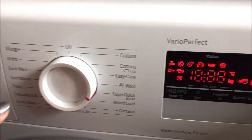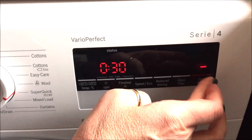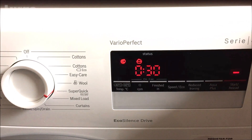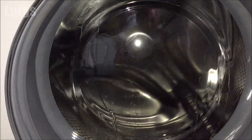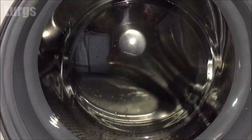As this is the first ever wash for this washing machine, I'm just going to put it on a short cycle. My wife is doing this step for me — a 30-minute wash with nothing in it, just to flush the system through. What you're doing is checking that the washing machine is working, that you've got no leaks, and that when it does its spin cycle it's nice and level and not rattling about. This footage is all speeded up.